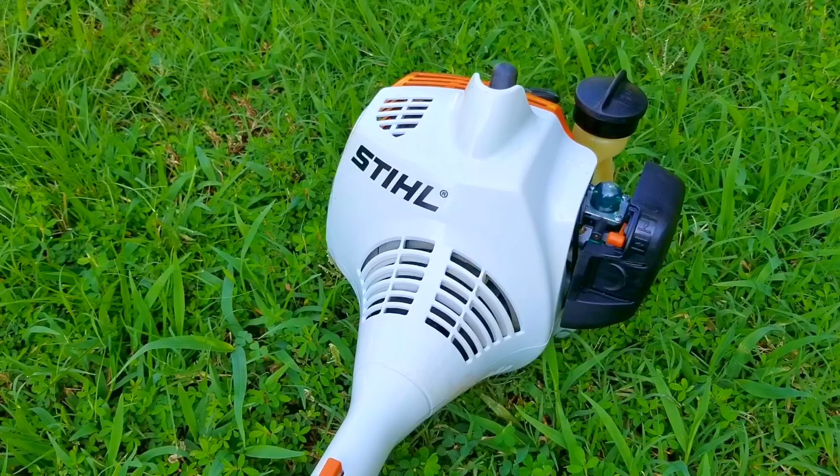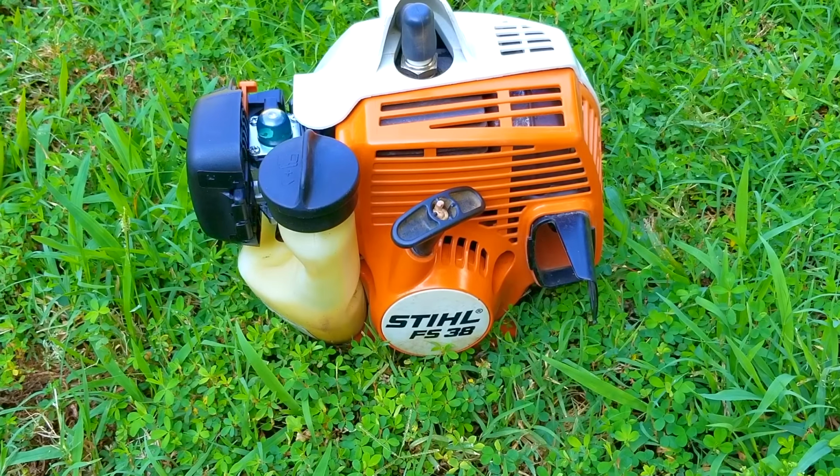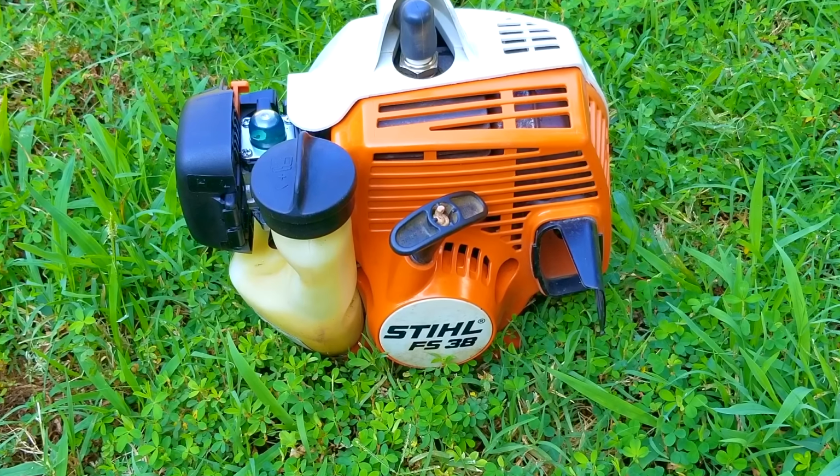I've only seen this once before where they had a 4-string head and was using the biggest line they could and had so much line out of the head that it was cutting as wide as some mowers. The fix would be to reduce the line count and size so it's not fighting the engine as much. So in the end, a blocked exhaust was the problem. However, I've never seen the tailpipe get clogged before the screen or even the exhaust port on the engine.